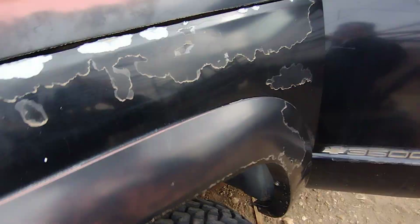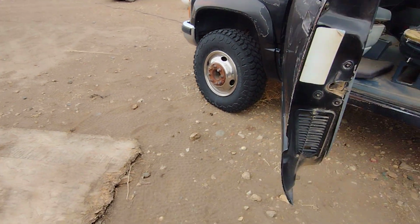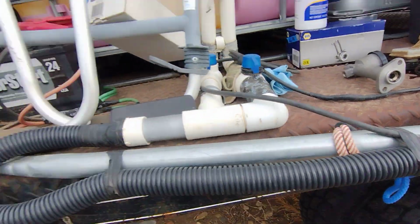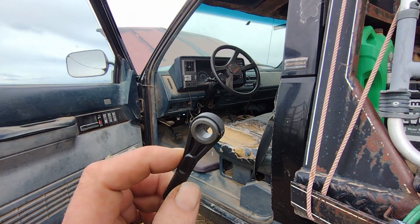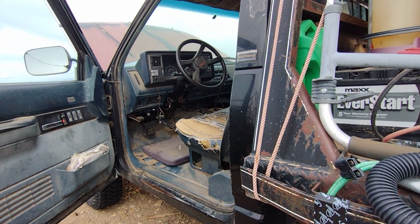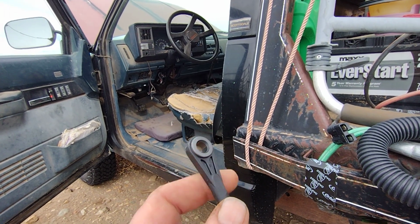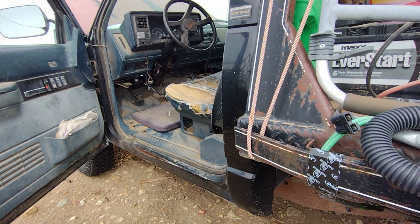Now on that plunger, there's a pin on the side of the clutch pedal, right in here. There's a pin, and this is going to slip over, and then there's a clip that'll go on over the top of the pin, the keeper, to hold it on. I don't think this will actually work its way off that pin, even without the keeper. I plan to put it back on. I'm just saying, if you get frustrated trying to take it off, there's a keeper on the end of it.